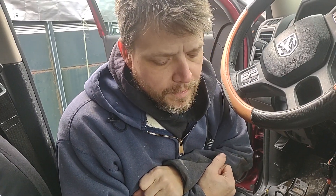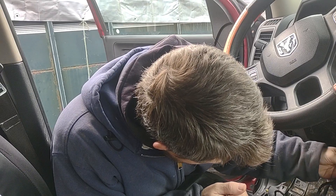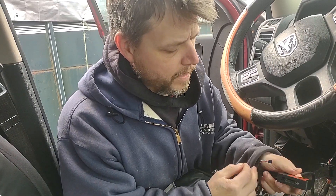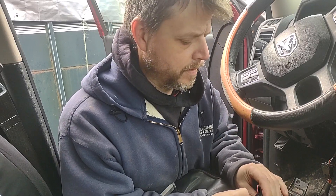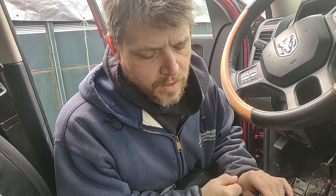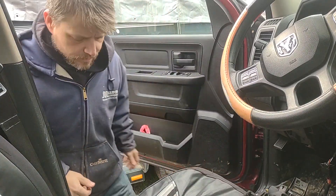Here's what we're going to do — we're going to start back at where we got everything plugged in. Everything seems good. Turn that off. Press and hold the programming button, while still holding it down connect the black connector. We're going to unhook the black connector, press down the programming button, and plug this in again. When the LED on the remote start flashes red, release the button — reset is complete. Close the driver's door, reopen the driver's door.